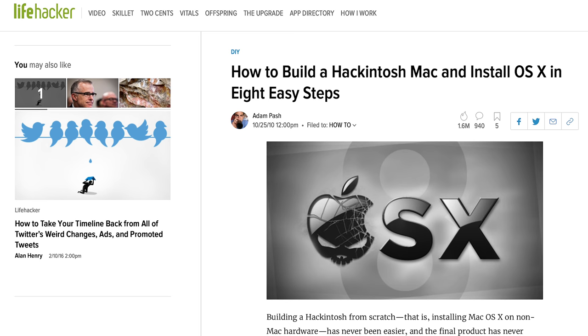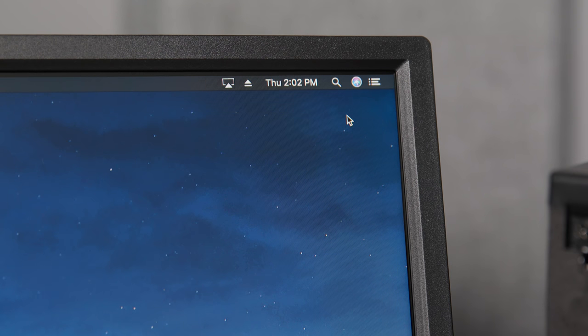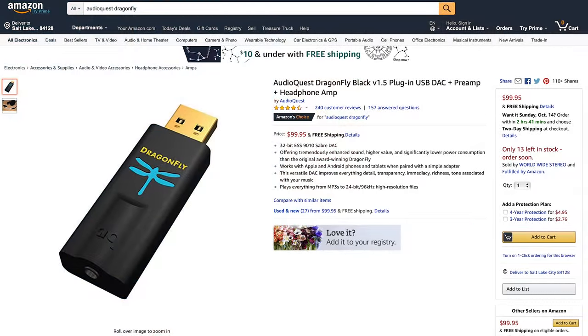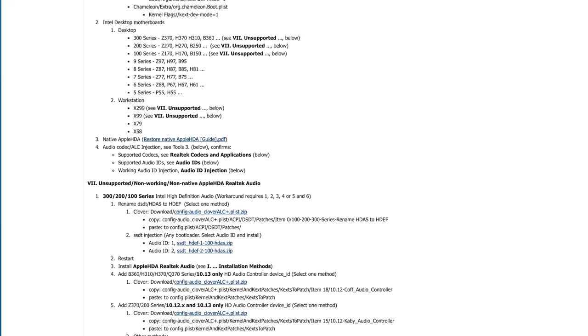But first, we've got to install macOS. Installing macOS on a PC has gotten remarkably easy in the last few years. While it used to be a big hassle to set up a Hackintosh and maintain it long term — you had to be careful with certain updates, you couldn't use certain apps — that's really no longer the case. Pretty much any hardware can be Hackintoshed, but some don't work all that great. It comes down to your motherboard. Some boards lack compatible audio controllers and require extra hardware like a USB DAC. Others need 25–30 minutes of software tweaking. But many modern motherboards, like the one in HackinMama, are basically plug and play and install as a real Mac would.